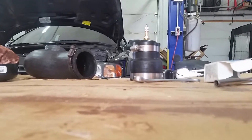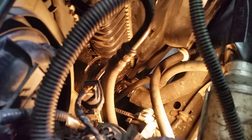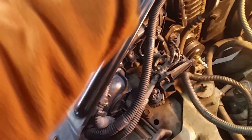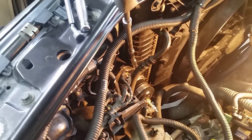This fitting is going to go on the car right down underneath these two wires. Right here you can see the intercooler hose — this is going to clamp onto that hose and seal off one side of the intercooler. There's a little bit of oil down this side too. Put the ratchet so you can reach it with a couple of extensions and not have to scratch your hands in the engine bay. Tighten that up securely — you don't want it to blow off, and we have to stop all the air from leaking out around it.